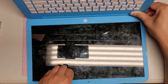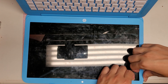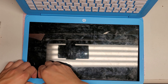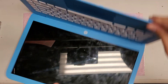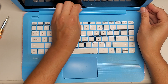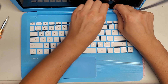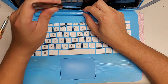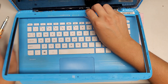I'm going to take the screen bezel out. To do that, you kind of just lift this. If you need to replace the screen, this will be helpful as well. You want to lift the middle while you kind of push the outside inwards — that's how you pop the bezel out. The bottom might be difficult. Peel it slowly; be careful because there's adhesive holding this. You might have to use a tool to kind of undo the adhesive. Push the adhesive away, and we got the bezel out.